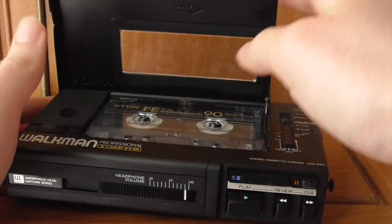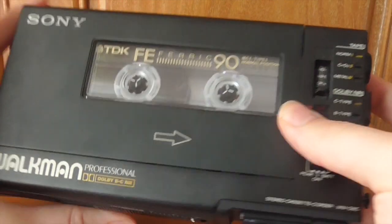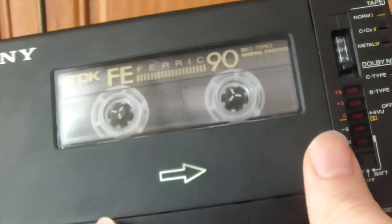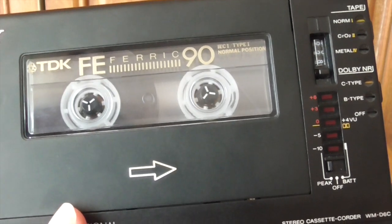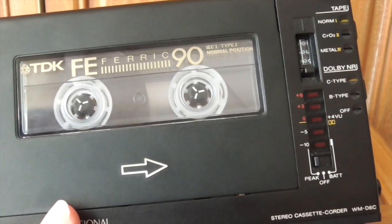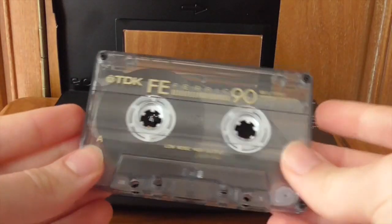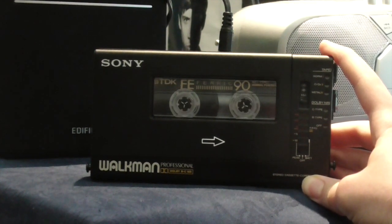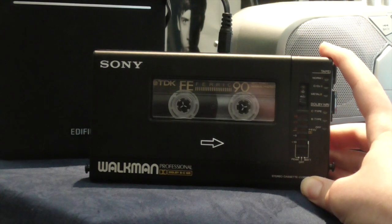To start recording: plonk in your tape, rewind to the beginning, set your volume, have your microphone plugged in, and hit record. As soon as you hit the record button you can see the cogs start to move, and with your microphone you speak into it. When you play it back you can hear yourself — works like a charm, very easy to use even though it's dubbed for professionals. Here is an example of recording on the Sony Walkman WM-D6C, played back from a Type 1 cassette in the D6C itself.